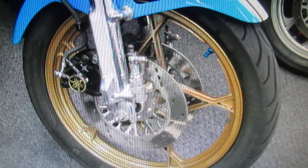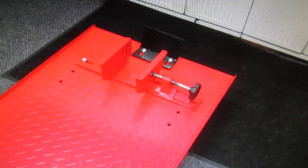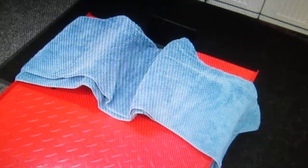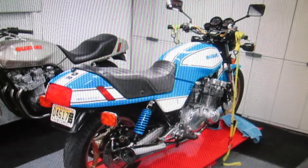The criteria here is not to scratch the rims - Glenn and I have both put a lot of time and energy into these rims. So the first step on not scratching the rims is going to be on the lift. This clamp trolley is already upgraded; I haven't upgraded yet, but I've been thinking about putting little pieces of rubber in there. For today, just putting a towel in there is just as good so it doesn't scratch the rim. I've seen a lot of people put a bike up on a lift, tighten up the clamp, then move the bike without loosening it and put a nice big gouge in a beautiful rim.